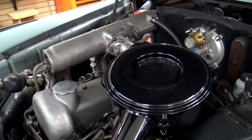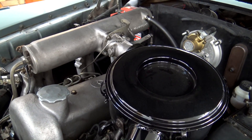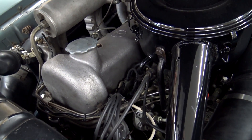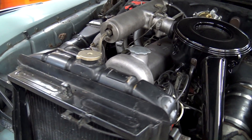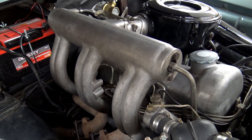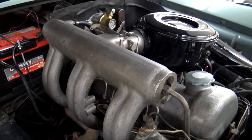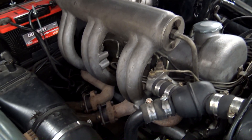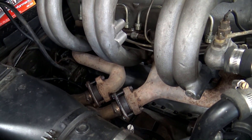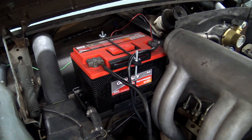I've got the hood tipped up here, and as you can see it's looking very clean under here as well. It's actually powered by a 2.2 liter single overhead cam inline six. This particular one has mechanical fuel injection because this is the SE model. They're not incredibly powerful — around 130 horsepower roughly — but a very smooth running and very reliable engine. That's why I actually see quite a few of these on the road still today. It's looking nice and very original under here. It does have split exhaust manifolds, so it can run dual exhaust — that's pretty cool. And of course they put a nice new battery in here.